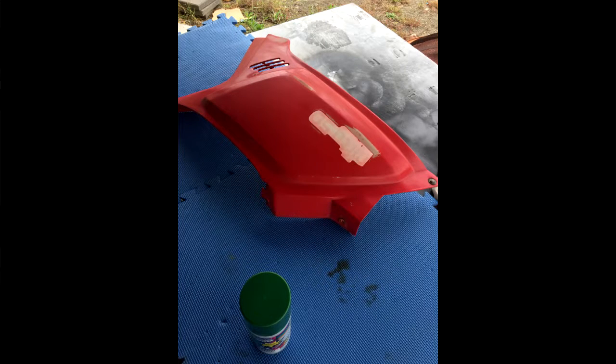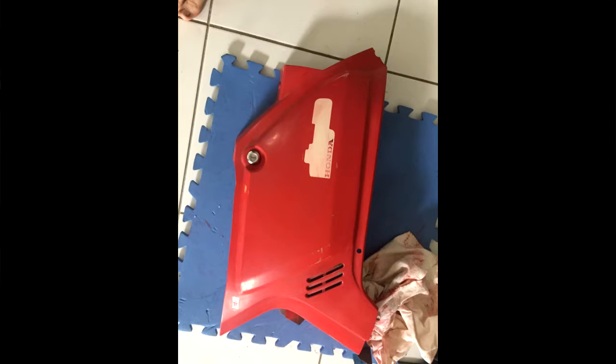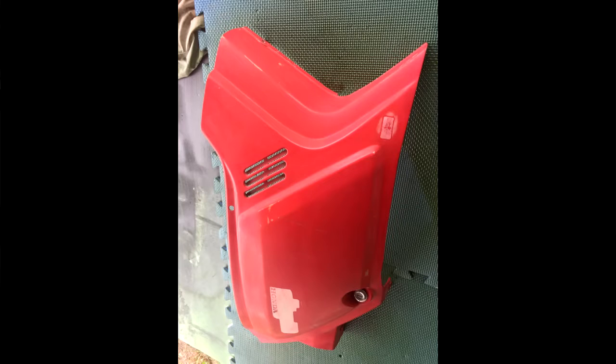So what you want to do here is the same process, except I've gone to a lot of, I'm not going to say care, but I spent a lot of time preparing the surface underneath. So you want to sand it with a rough sandpaper to get everything off, then gradually smoother and smoother. So I don't know, 600 grit, 800 grit, 1000, 1200 if you want to do it that gradual. If you don't prepare the surface well, it'll look like crap.